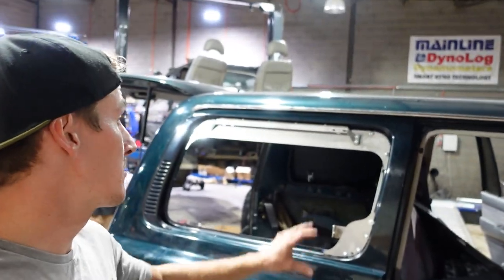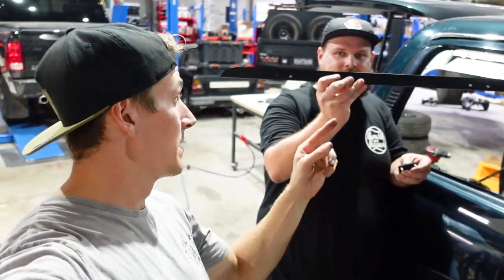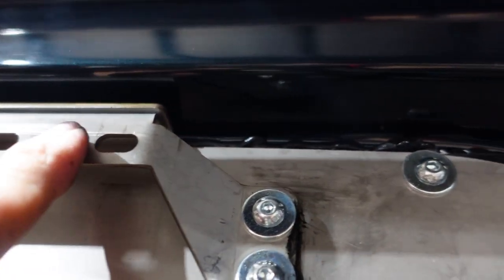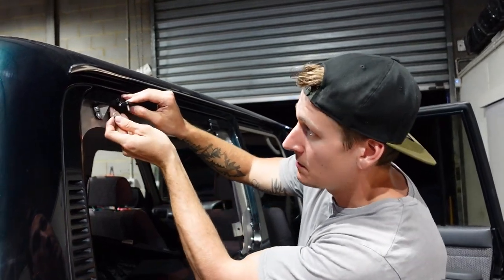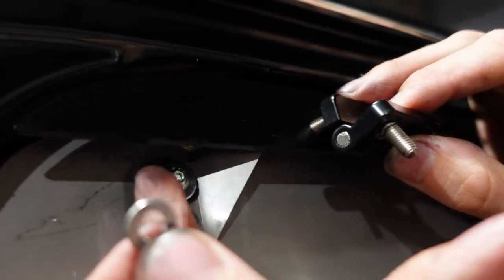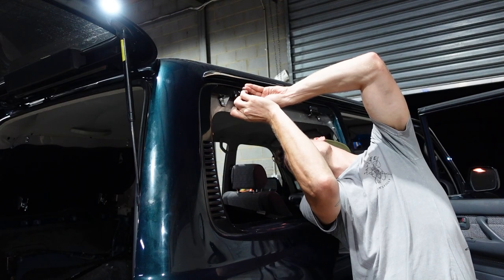The top piece and bottom piece are in place, all siliconed and ready to go. The next step is to grab the top plate — number two — and put it onto the plates three and four assembly. You also need to grab the hinges — there are two of them — and basically they go through this section. They're slotted so you can keep them loose and move side to side to get your alignment. It's a little bit fiddly to get the washer and the M6 nut up inside there, but it is doable. The reason we're doing it this way — differently from the instructions — is because those top mounting bolts are really hard to get to once this plate is on.